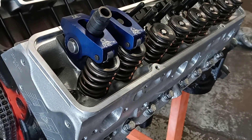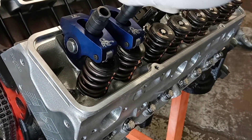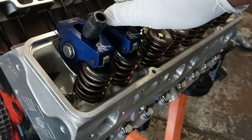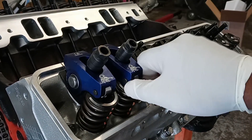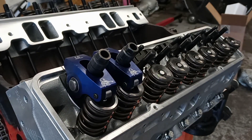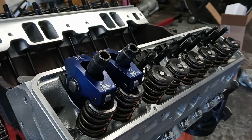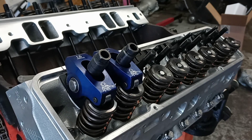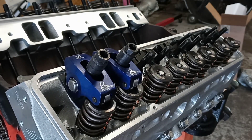Let's figure out why this one isn't going down — it wasn't lined up correctly. Screw this one all the way down, snug it, no movement, then back up an eighth of an inch to give a little play. Now we're going to rotate the engine. Anytime I'm doing a solid roller valve adjustment I use the EO-IC method. We're waiting for the exhaust valve to open — as soon as it starts to move down, you adjust your intake valve.